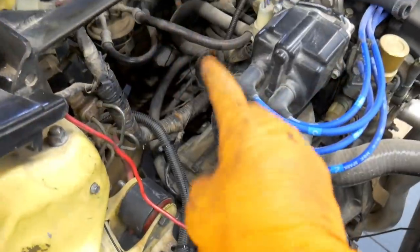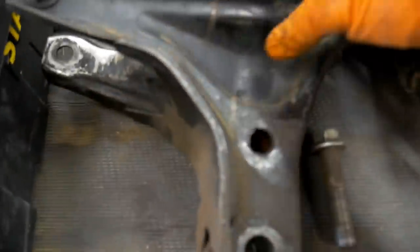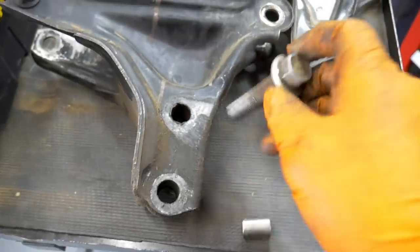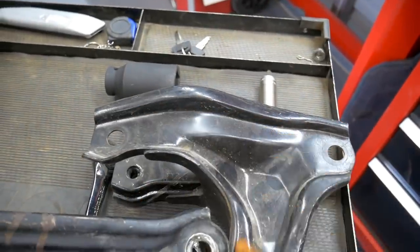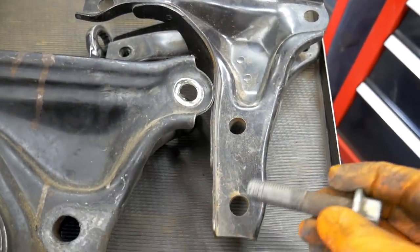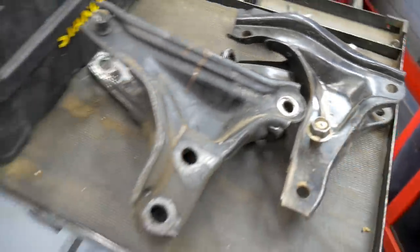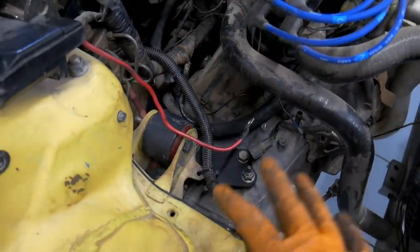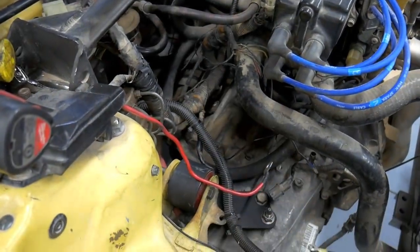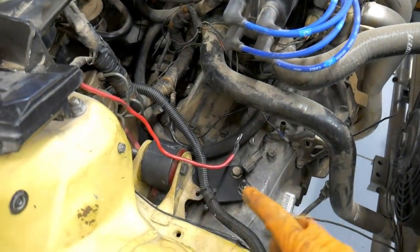One thing I forgot to do, unfortunately, this is off of an Integra T-bar. The bolts that go through here, that bolt up to the transmission, are much larger. It's a bigger diameter bolt on a DA T-bar. These holes are too small. This is the one I was supposed to swap out. It fits now. I think I might have to pull the transmission off. I don't know if I'll be able to get it removed any other way. I'm gonna try. I got it disconnected from the mount. Unfortunately, I might have to backtrack a little bit.